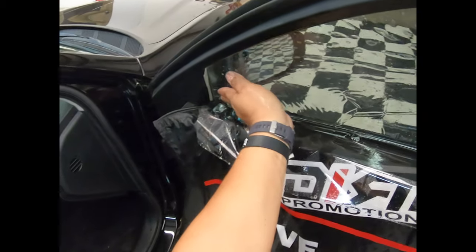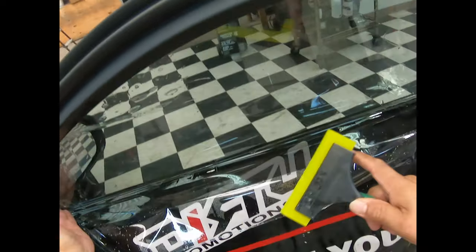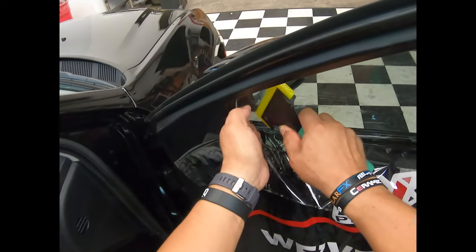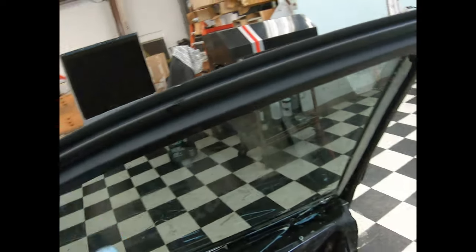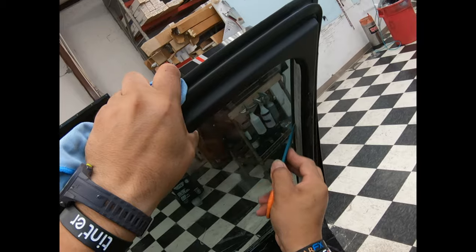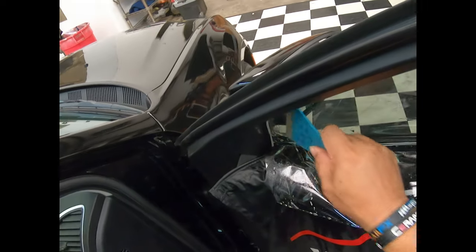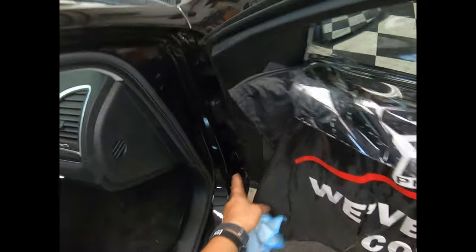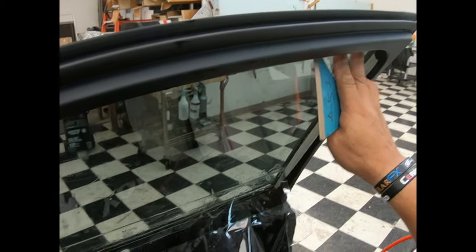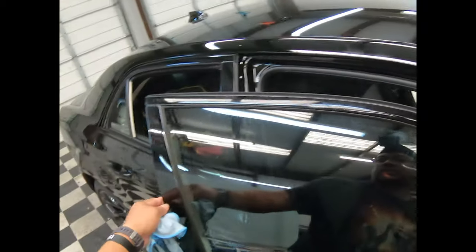Go ahead and stretch your film and manipulate it so it won't have fingers on the bottom. Even if the film is completely flat, if you distribute it wrong you're going to have a bunch of little fingers. And because this thing has a gasket on the bottom, you're going to pay the price — you'll get little fingers, try to take them out, get contamination, creases, scratches. All that stuff is always happening. Gap light looks nice all the way to the edge, film is in there, no contaminants as of now. I like what's going on.